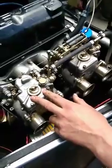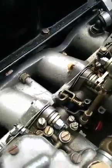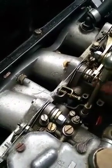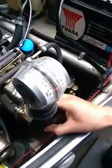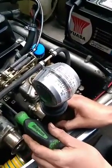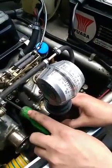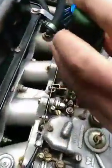This is your leading carburetor and this is the one you'll adjust by looking at this linkage here. We put the synchronometer back into this carburetor. This is the linkage we adjust here — that's the fixed one, this is the one to adjust for this lever. We've put the synchronometer back in the carburetor to adjust, and using the screwdriver with the screw there we can then turn it. We need some more throttle — he's adjusting the idle speed.